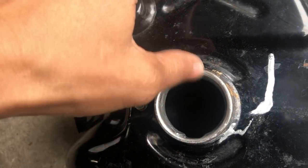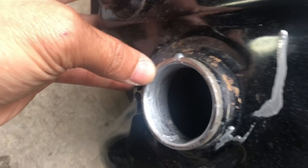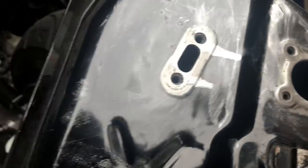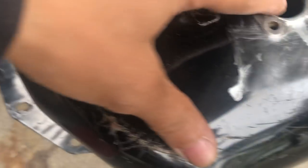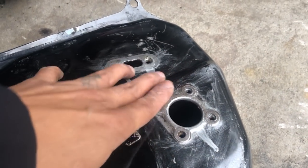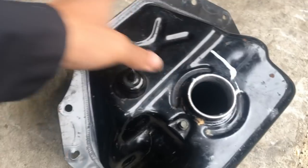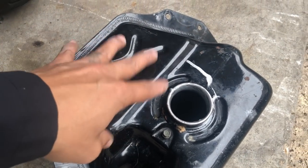So I also have the question of if this bike is still 50cc or not — I don't have a history. So maybe someone put a 70cc kit on it, and that's evidence that someone already jetted up. Why would they jet up that high? We'll see on the episode where we take apart the motor. Before we're done with this one, I want to give you an update — the fuel tank sealer is dry but not fully cured yet. But this stuff on the edge is like an extra layer of metal or skin. It's coated the whole inside of this tank, and it's smooth and tough. That stuff's not coming off. So this is a good product — this POR-15 stuff — if you have a tank that's not completely dead but you want to restore it, this is a good solution for you.